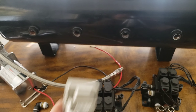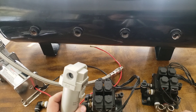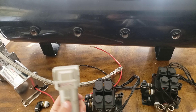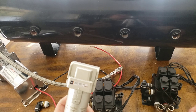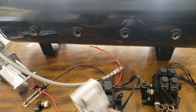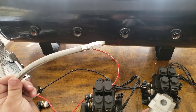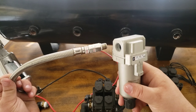Now I'm going to tell you more about an air dryer. With compressed air — or air in general — there's a possibility for water molecules to be in the air itself, like moisture or moist air. So the air dryer will help protect moisture from getting into your lines and inside your tank. The instructions for my kit just tell me to connect the compressor directly to the tank, but I'm actually going to connect it to an air dryer first and then connect the air dryer to the tank.